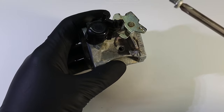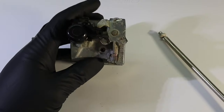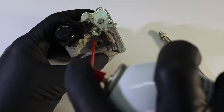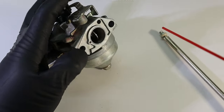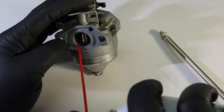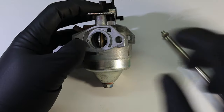As long as you're using a number two Phillips head screwdriver, you shouldn't have any problems. Righty tighty, lefty loosey — and she's out. Go ahead and grab some carburetor cleaner and let's clean this jet out while we have access to it. If you're not familiar with this little carburetor, the ports on these are very, very tiny and they give a lot of headache to people. So anytime you've got a chance to clean out that carburetor, do it.